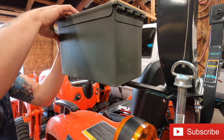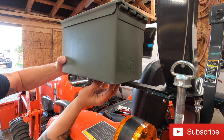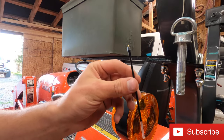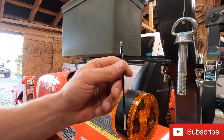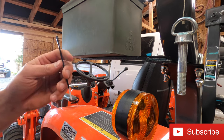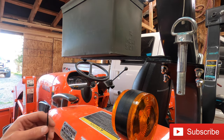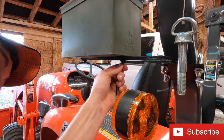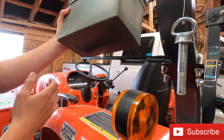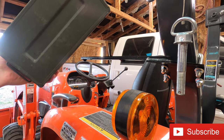So what we're going to do here is play the balancing act, mark some dots from the bottom with a sharpie and drill our holes. We're going to use just the ink tube of a pen to mark out the holes we need to drill, and then we'll get a cleaner mark with a sharpie after. The reason you can't use a sharpie is because the holes are too deep with the nuts there — this is really the only way to mark the hole. So we have our hole here and our hole here that need to be drilled.